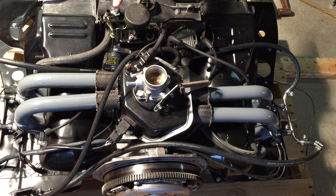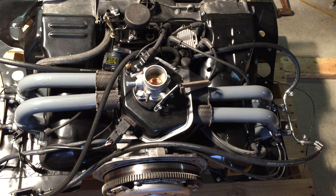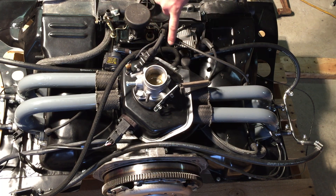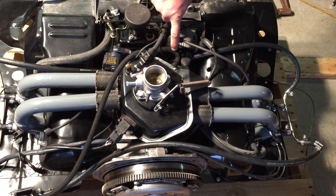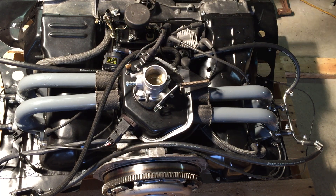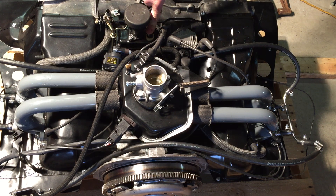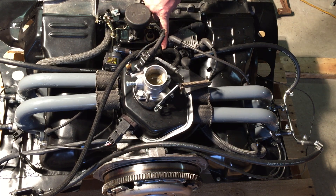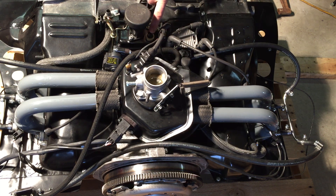You've got a few breather connections that also need to go to your filter box. This side is from the heads, and then the PCV valve as well — those should both go to the breather box. This was originally plumbed into the plenum, so if you want to route it into the idle air valve instead, that might be a good solution to keep oil from the PCV valve out of your air box. You'll need some adaptation though, because this hose size is smaller than that connection.